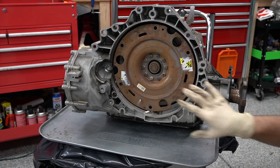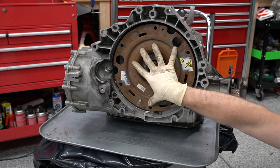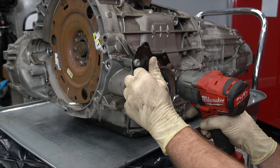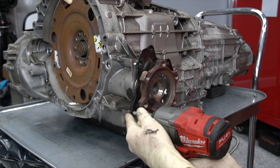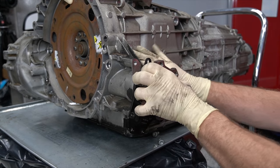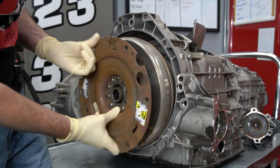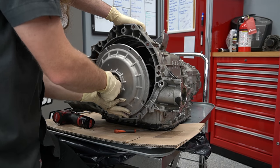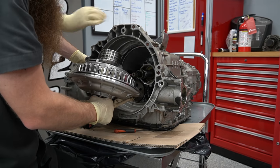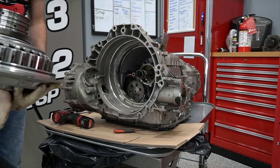All right, our plan is to first get the clutch pack out of our transmission on the bench. Now, it would be cool if we could just pull this clutch pack right off, but this axle shaft actually runs all the way through. We can't pull this off with this axle guy here in the way, so we need to get this off. Oh, wiggle it. How heavy is that? Not that heavy. Oh, my finger. There she is. That actually wasn't too bad. Would you just look at it? You can see all inside that pretty transmission.